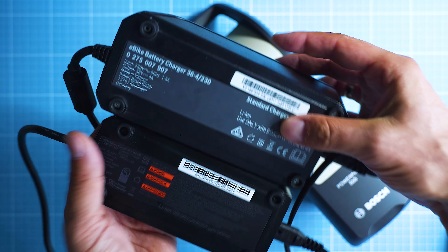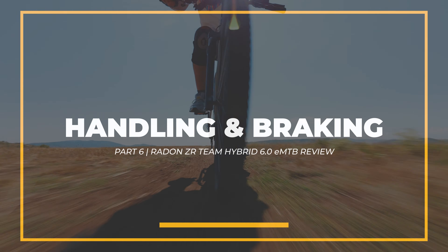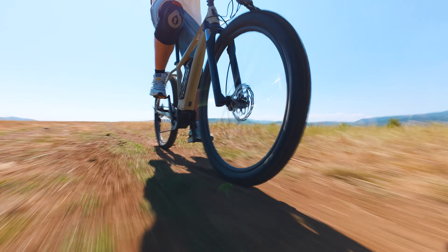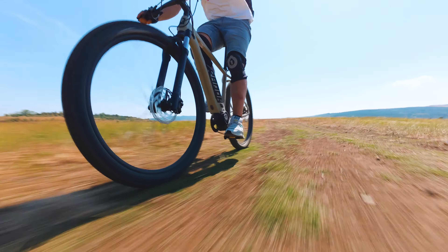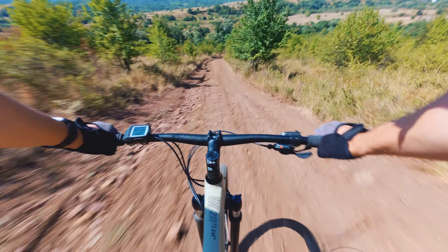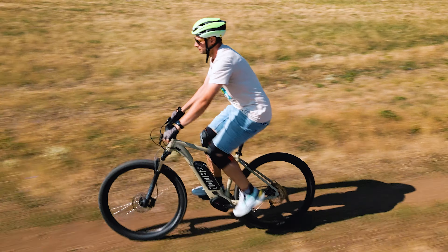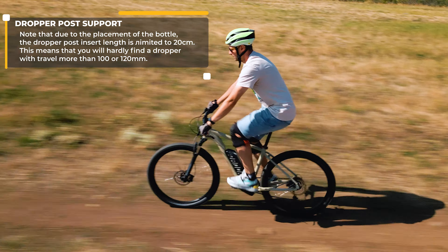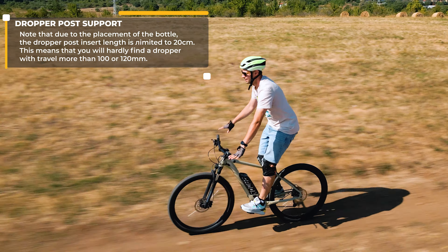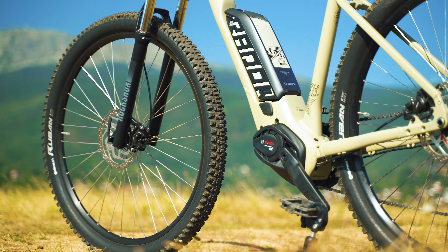Since Radon includes the slower 2-amp charger, it's going to take a bit longer to recharge. You can buy a 4-amp charger if you want to speed up the procedure. Riding the ZR Team Hybrid 6 is rather boring perhaps — the frame is intentionally designed to be somewhat conservative. The head angle is 70 degrees, a bit too much for pure cross-country, so it's perfect for flatter terrains. There's a 720mm handlebar, pretty good for the bike's geometry. The bike is mostly going to be used by my wife and son so I chose size M, suitable for heights between 170 and 185 centimeters — though I feel comfortable on it too despite my 188cm. No dropper post comes as standard, but given the nature of the bike I'd recommend that as one of your first upgrades. The bike does allow internal cabling for a dropper, maintaining a cable-free frame — a pleasant surprise at this price point.